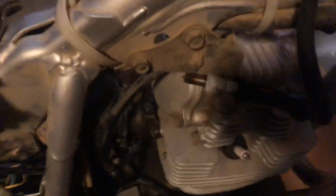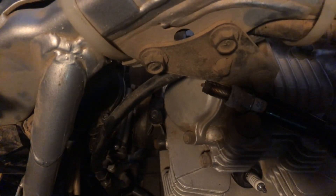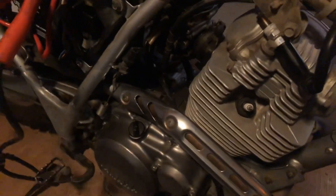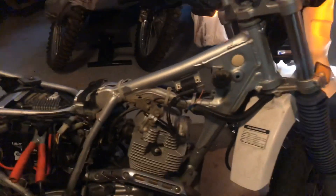I've got the booster on here. I shut the garage door and turned off the light to get some darkness so we can take a look and verify we've got no spark — and I see nothing. Before we go much further, I want to point out this splice on the wire going to the hot side of the coil. That ain't great. There are a lot of these around this bike, so I have a feeling we may be chasing down a wiring issue.